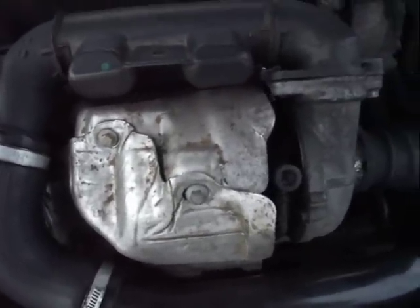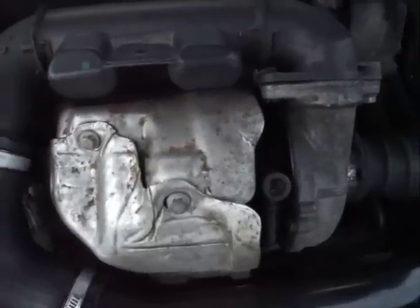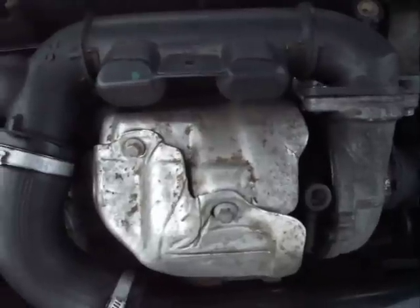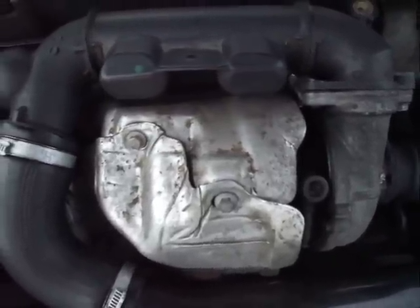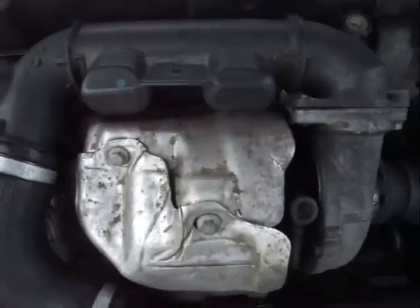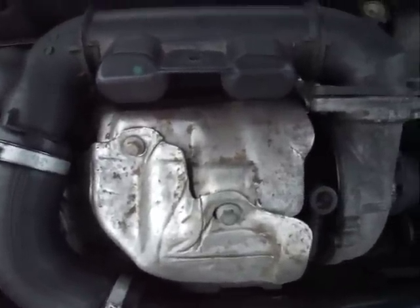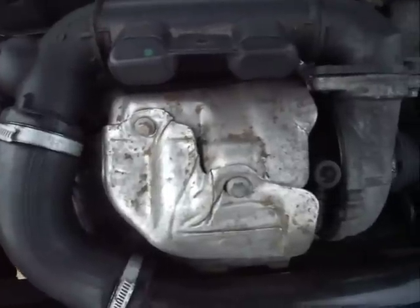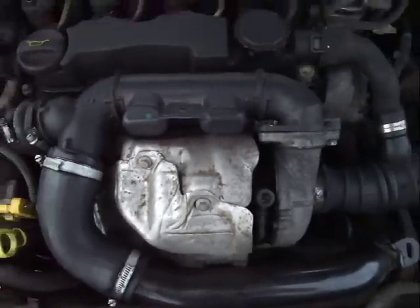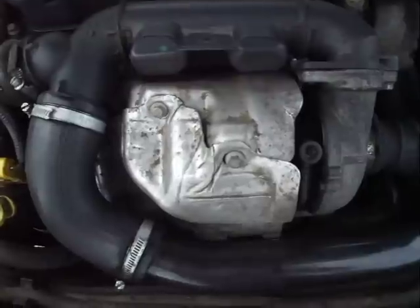Then what you'll need to do is to backwash it by just using the garden hose. That is fine. Don't need to use a pressure washer because it's quite a long tube with a bit of bend in it, so therefore no point using a pressure washer. But keep filling it up with water, giving it a really good shake and then pouring the water out. You'll find the water is quite a browny orange colour, and it took me about 3/4 of an hour in actual fact to actually get the water reasonably clean.